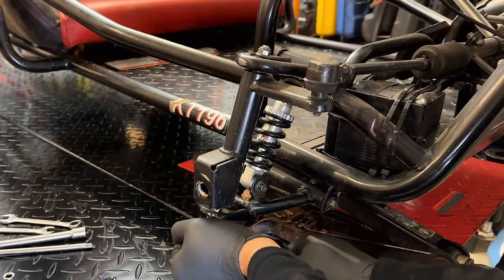And next, I'm going to try to get this torque converter cover off. There's just a few 8mm bolts going around, and once those are out, theoretically, this cover will just come off. My concern, though, is this frame rail. It's right up against the cover, and actually, this is as well. So I'm not sure if we're going to be able to get it out of here until we get the engine out. But I do want to get it out now, if possible, because that's going to give us a little bit better visibility as to what we're doing down below.